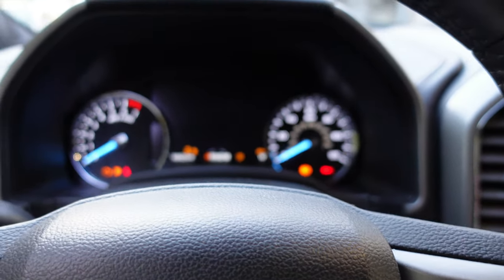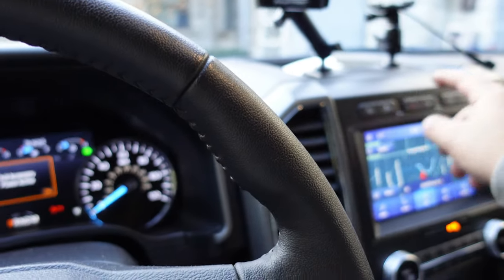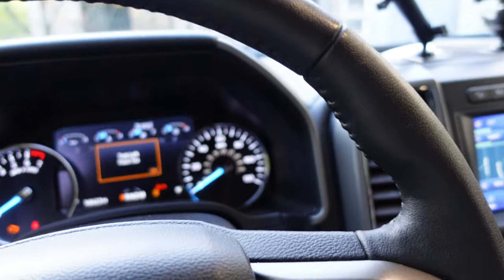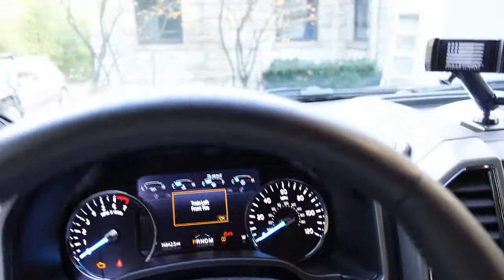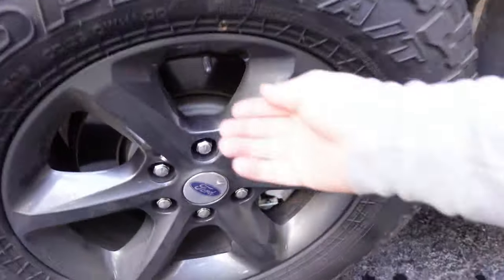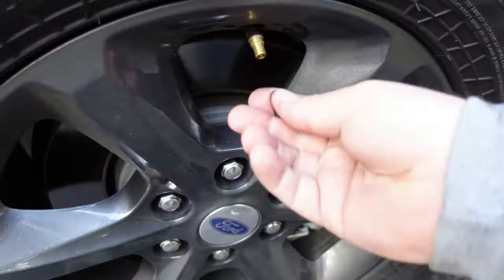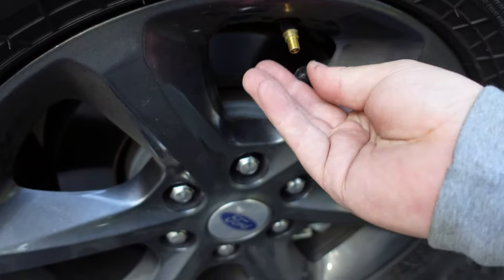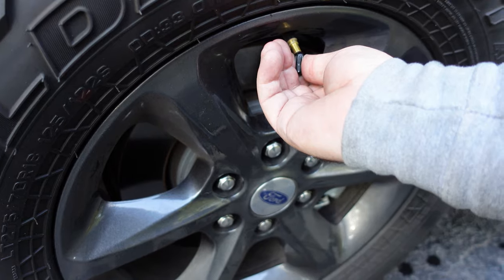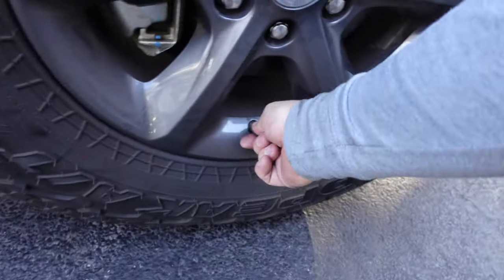You want to turn the car on without the engine turning on, and you want to hit the hazard flashers three times. Now it is in tire train mode — hitting that three times puts it in tire train mode. Now you're going to go to the left front tire and let air out until it honks. Now that tire is programmed. It says 'train right tire' — you've got to work clockwise around. So let's do the same thing here.